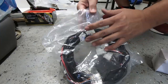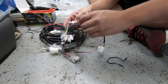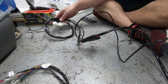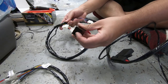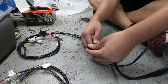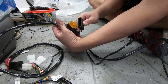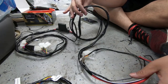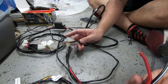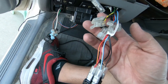Next is to tackle the wiring. This little one is for the switch for the interior to turn the air compressor on and off. This is the main harness, which plugs into the relay — also supplied. There's a fuse, a big 40-amp fuse. At the other end we've got some connectors, and I'm pretty sure this is for the positive and negative and the switch. This is the harness for the switch, and this harness is able to do three switches: your compressor, front locker, and rear locker.